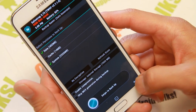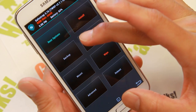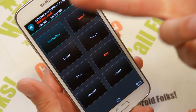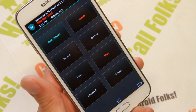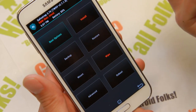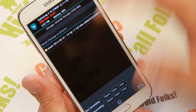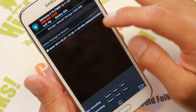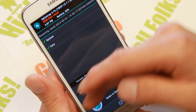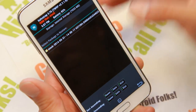When it's done, go ahead and install your ROM. If the backup takes up too much space, you can back it up to your internal storage and then copy it to your computer, so you always have a backup copy. Anytime you want to restore your ROM — if something goes wrong — you can hit Restore here. I've actually backed it up, and you can go ahead and hit the button there and swipe to restore. This will get you back on whatever ROM you backed up.